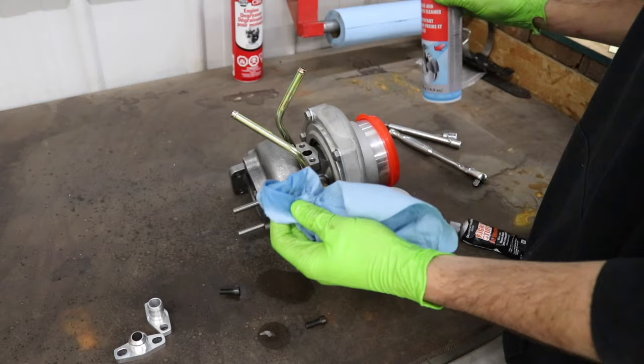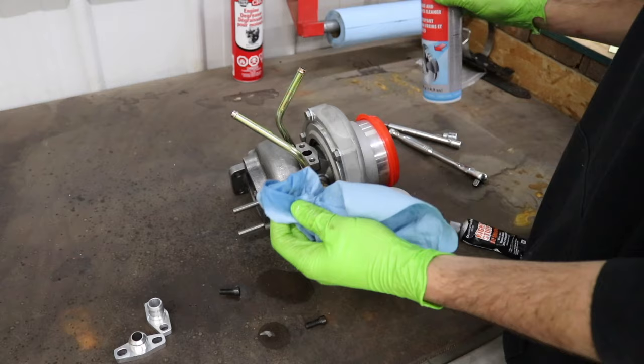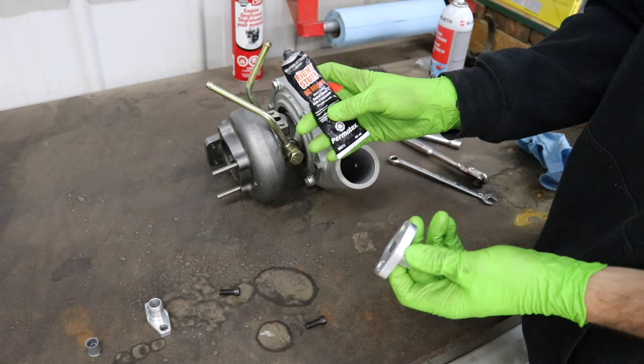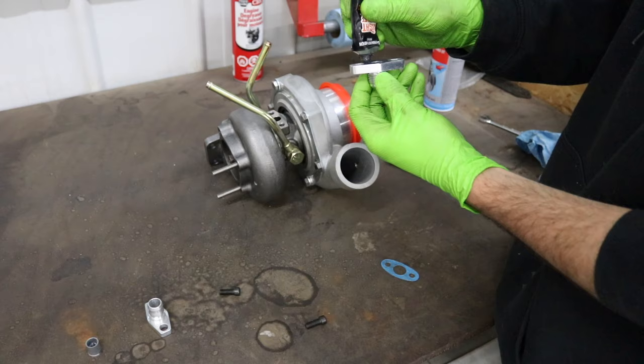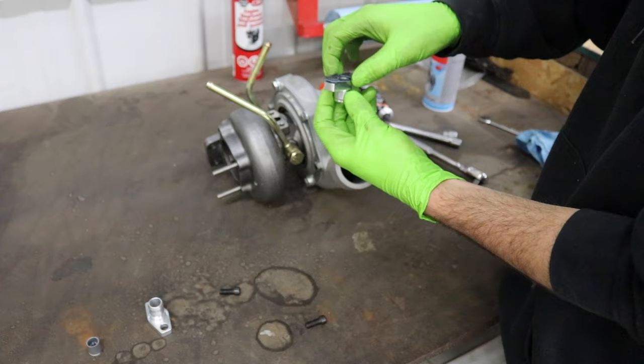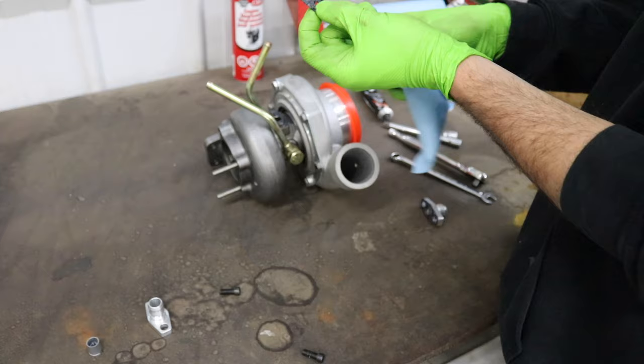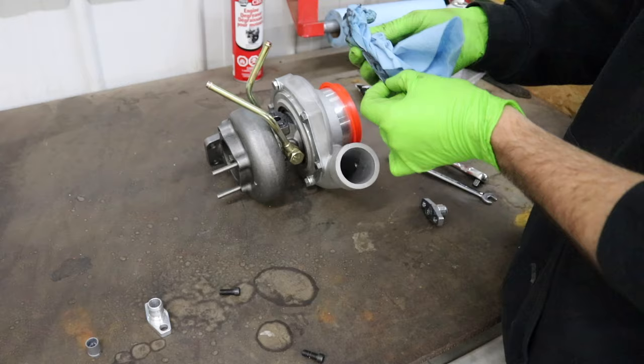We don't want to spray brake clean in the turbo, so we're going to spray it on the rag and give it a good wipe down because there is a lot of oil sitting on this flange. That silicone is not going to seal if we put it on oil. So I'm going to take this black gasket maker — the right stuff — and run a very light bead around the oil drain. Doesn't have to be much, don't cake it on there. Set that on the turbo and it should seal 100%. I barely put any on there and I put too much — as soon as it squeezes out, don't use it because you're going to get silicone in your oil galleys. So I'm going to wipe away some of this and get it slapped right back on there.